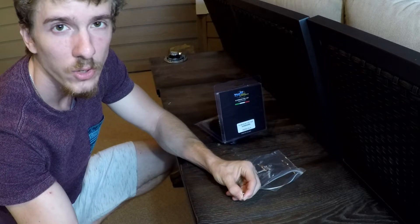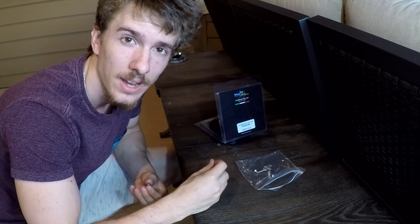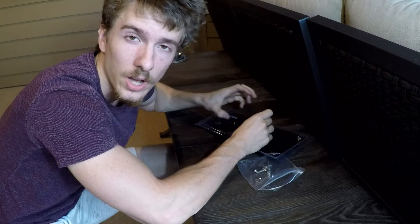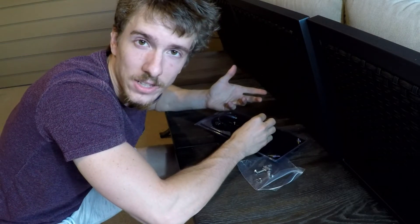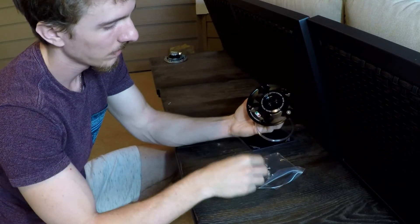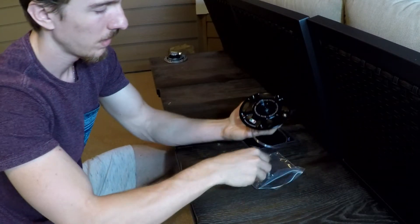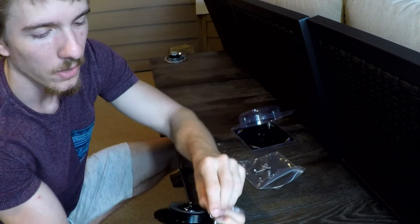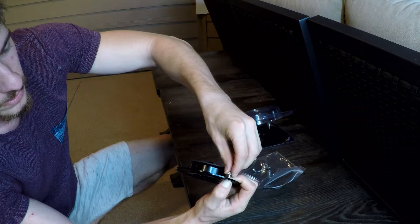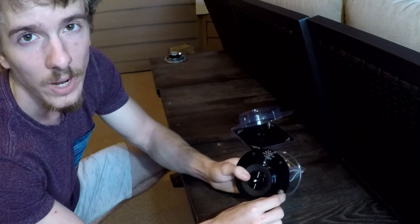TWM also supplies shorter screws — the shortest ones in the bag — as well as a washer and a nylon lock nut, to take the place of the decorative screws on the stock gas cap. They don't screw anywhere into the tank, but you still want to fill the holes. Slide your screw in, then place the rough side of the washer down against the gas cap, and thread on your nyloc nut. Do the same on both sides, then tighten them down with a socket so they don't rattle loose while riding.